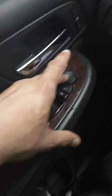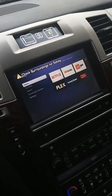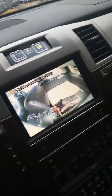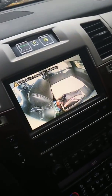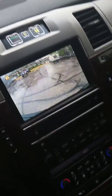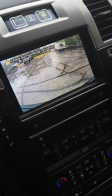This requires what's called a Nav TV Barracuda. It actually wires into the mirror controls, so if I press up they have an input for a front camera. I have a switch box back here and I've put in a camera for the back, so when the dogs are in the truck it's simple to switch over to the camera while driving and see what's going on. I can also press back and see the backup camera at any time — once again that's the Nav TV Barracuda that you need for that.